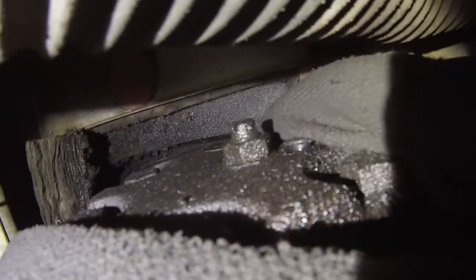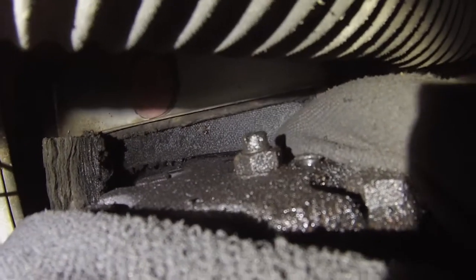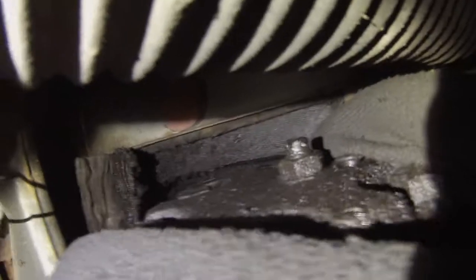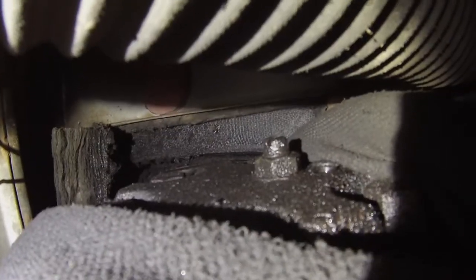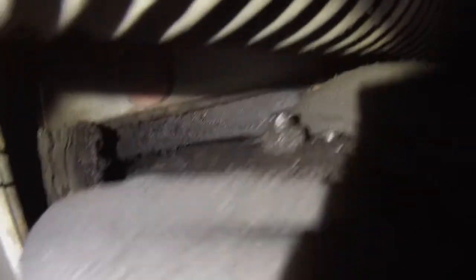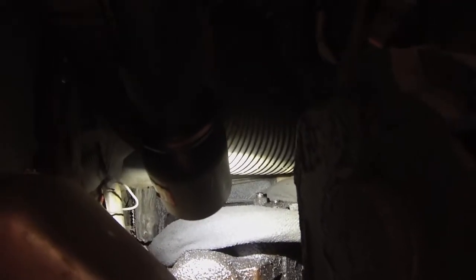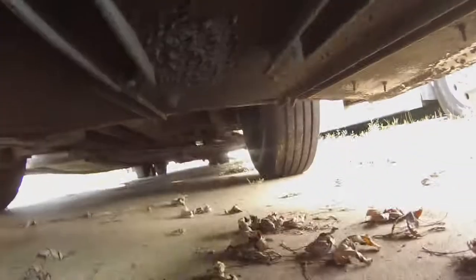Right there — what you do is you unscrew that little lock nut, then run that slotted nut in enough to take the slack out of the pinion. Run that in a little bit and it'll tighten up the steering and help you a little. You can't tighten it up a whole lot because then it'll start to bind. You want to feel it start to drag just a little bit, and you've got it.